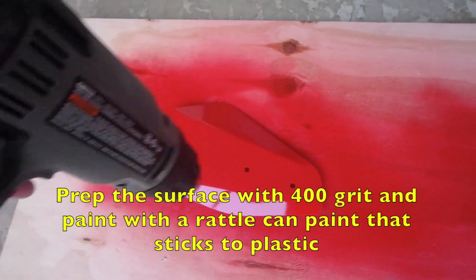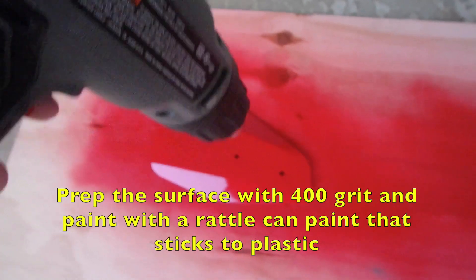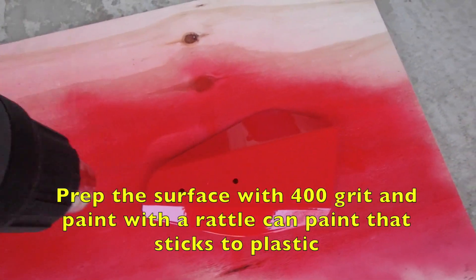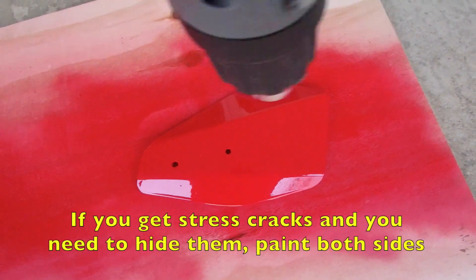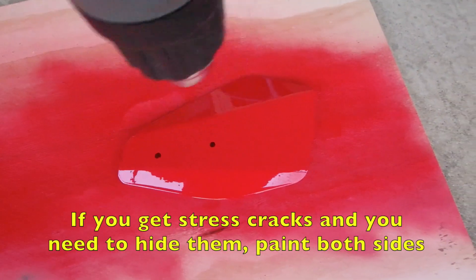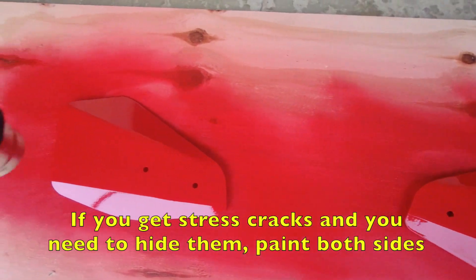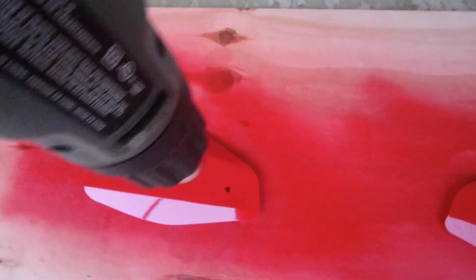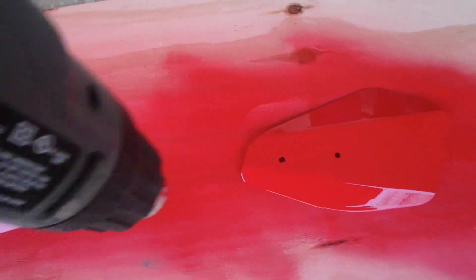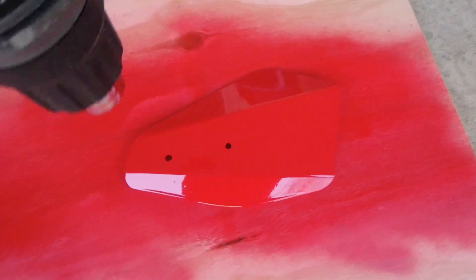The trick to doing this right is to hold your hand about 12 inches away from the heat gun. When your hand starts to get too hot to tolerate, that's when you know you should move the gun. For me, it's about five seconds at about 12 inches. I'm constantly keeping the gun moving at about 12 inches so I don't ripple the paint or burn it.